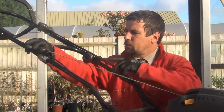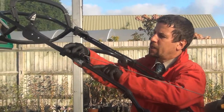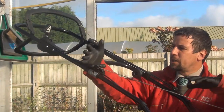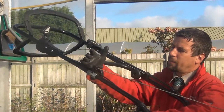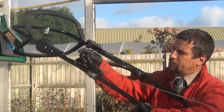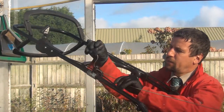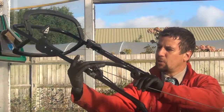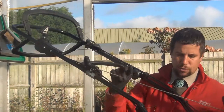We look at the handle up here — this one goes round a spiral of metal so when the operator is starting the machine, they're not having to bend right down. You can pull it from up there. On this one you want to make sure that it is fairly tight. If it was hanging down in operation, you would need to re-tighten the recoil. But that handle's fine.